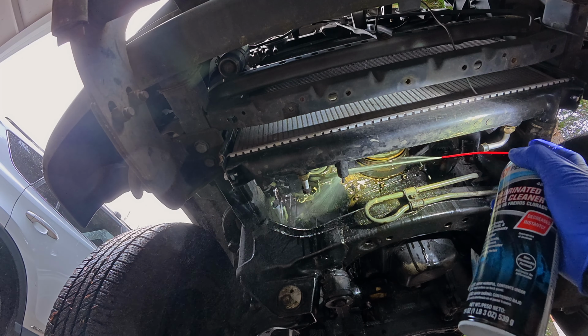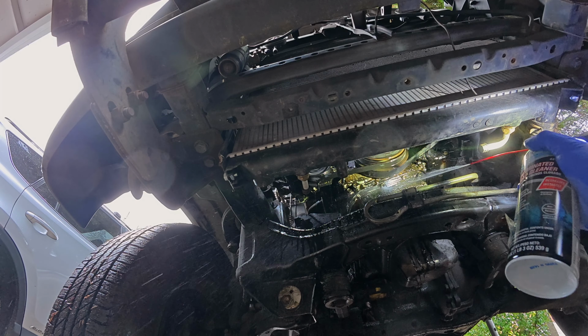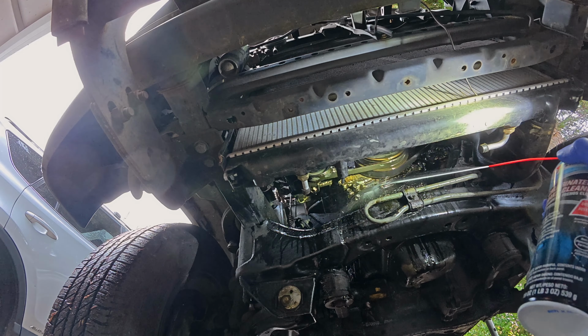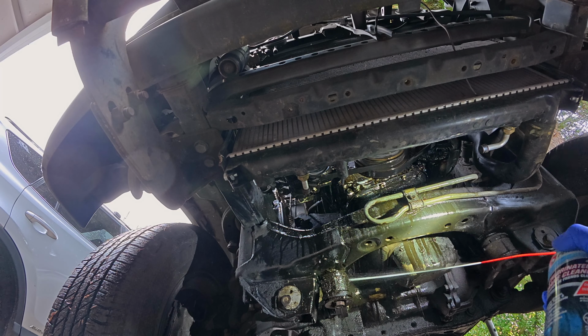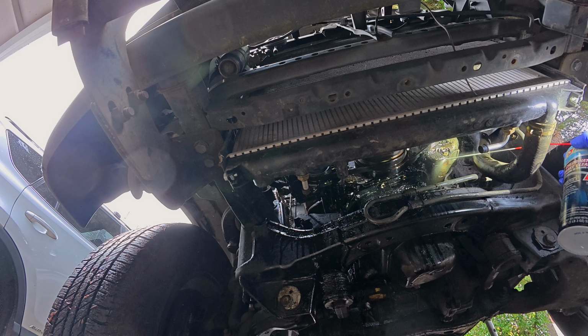This is the precise reason you need to diagnose oil leaks. It could be an oil pan, a front seal, or an oil pump seal on the front of the engine. The oil pan is extremely expensive to replace because we need to remove the differential. So we need to find the Exxon Valdez leak, because I'm sure everything's leaking, but we're trying to find the worst leak on the car that's dripping on the ground.